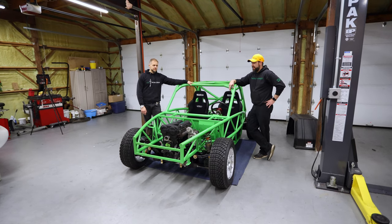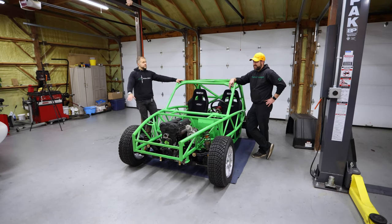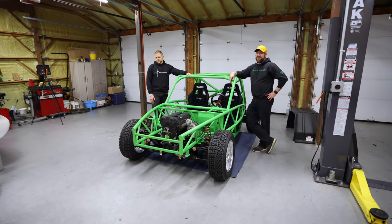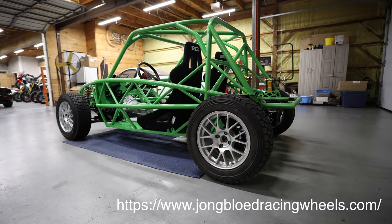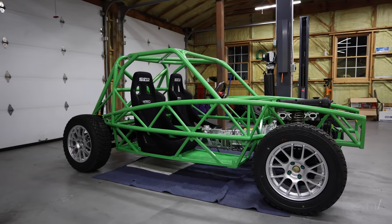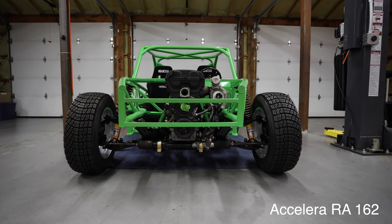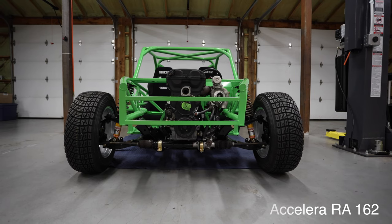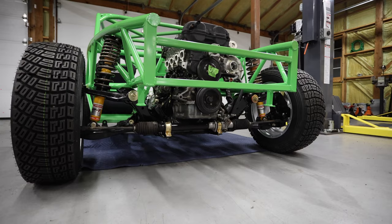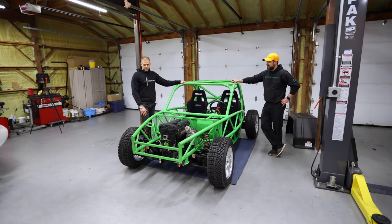It's long travel. The wheels and tires are from our good friends at Youngblood. This is their spec Miata 15 by 7 with a plus 25 offset. And then for the tires - this is a Kenny recommendation - Accelera rally cross tires. They're stiff and they're heavy because they've got steel belts in them for reinforcement. We're gonna have a separate set of wheels and tires when we actually want to do pavement stuff with this thing.